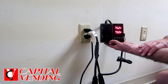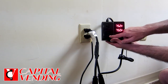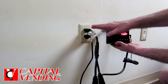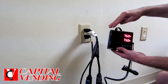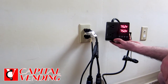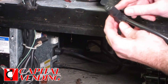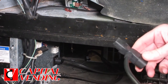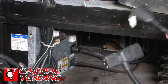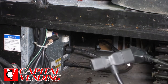Because of the way this is built, we have this cooling option here. Since this is digital and we can turn it on and off, you really don't ever need to worry about the compressor coming on within the soda vending machine. This is where you would plug the refrigeration system. We recommend going straight from this to the wall outlet rather than cutting wires in your machine — it's a lot quicker and looks a lot nicer. On newer vending machines, the power cord has a style connector. There are a couple different styles — Dixie Narco and Vendo. With this adapter, there's no need to run the extension cord behind the machine. Two different ways of supplying power, and each kit has its own part number.